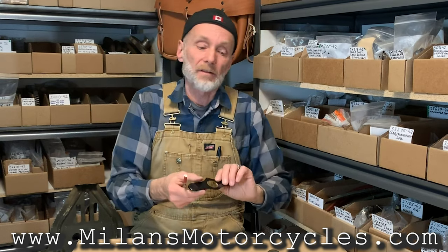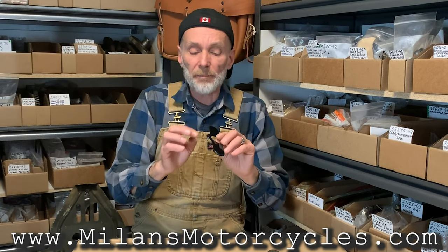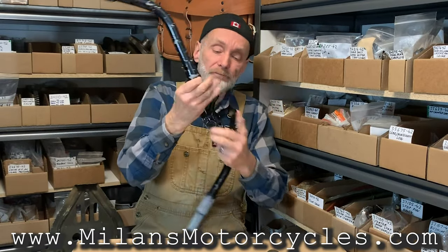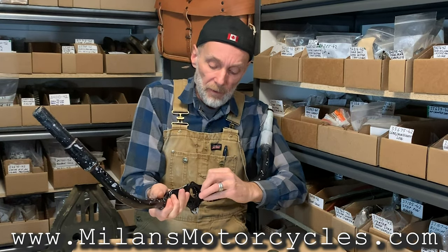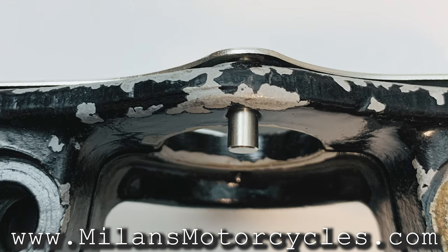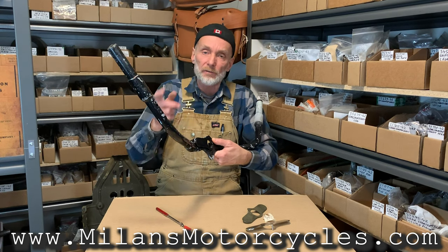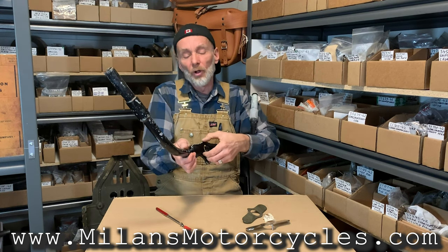Like the originals, those have stainless pins, even on the army ones. Now, why is the pin on it? What is the pin? Sometimes you can buy them at the swap meet without a pin, but the pin is critical for safety. This is a set of handlebars from an XA — original ones. Basically the pin slides through the handlebar and locks your top cone for adjusting the bearing preload. If you don't have that, there's a chance of it loosening up. So that pin is quite critical and you always have to have it.